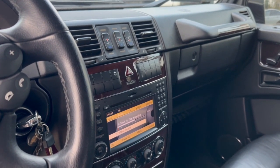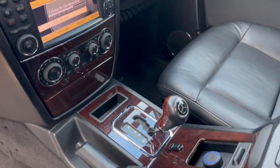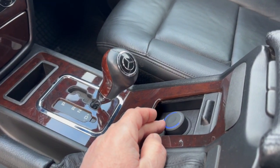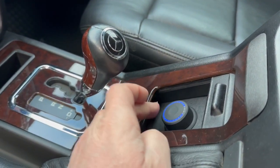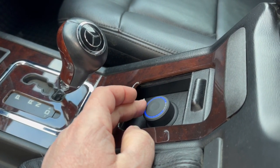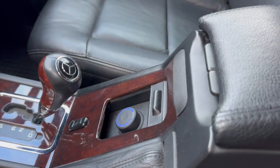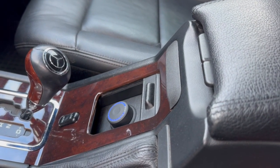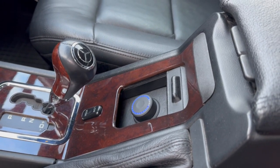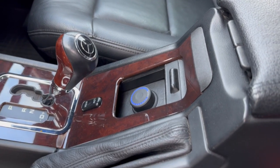So it's the brand new Audison integrated amplifier and DSP. We've used three of these this week - they've only just been launched and we're very happy with them. This is a new DRC controller. We've built this angled panel and set the controller in there, and it's got several purposes. At the moment it's doing master volume, but it can also control the time alignment - six time alignment settings or presets. You can switch between presets, adjust the subwoofer level, change your EQ curve, and operate the master volume.